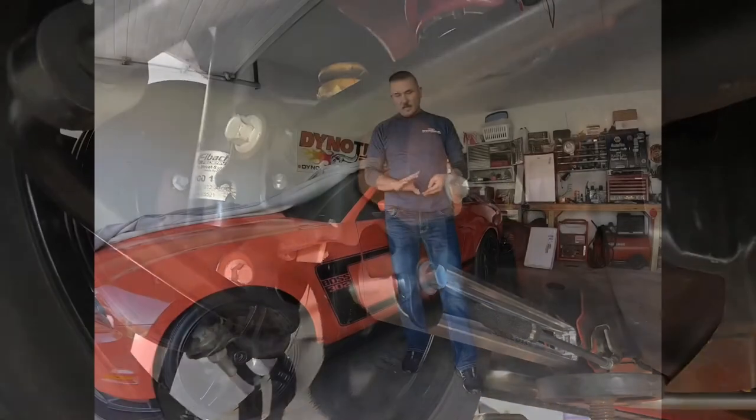So we went to work on suspension. What we've replaced: we got the Steeda-built aluminum lower control arms, the upper control arm, and the torque box braces — it's a three-point brace. We're going to open it up and take a look at it all. The reason we're working on the suspension is we're trying to plant our wheels down to the pavement and also stiffen up the chassis to reduce any chassis flex.